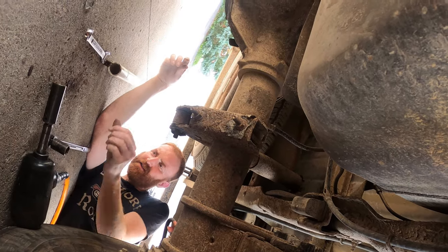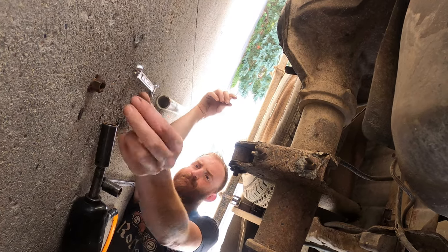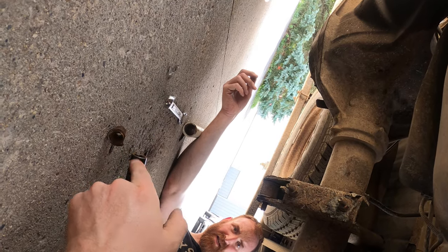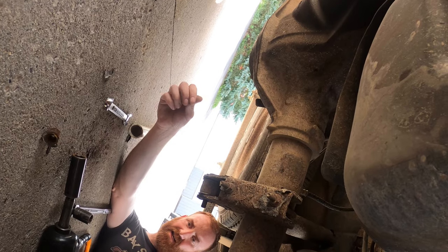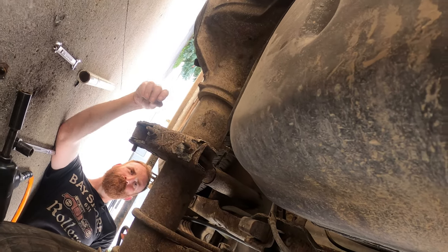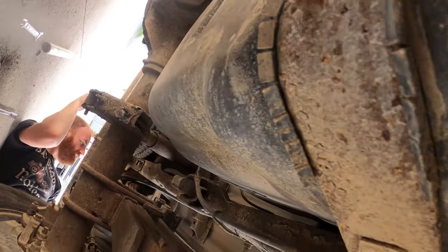Yeah, it was new. Look, it broke that built-in washer. It's a little warm. Wow. Maybe you should get a new one of those. Well, it bolts to the metal on either side. Could just put a normal washer under it. Yeah, because it's torqued to medium, right? Metric medium? No, this would be by 2004, so it is metric. So metric medium torque.